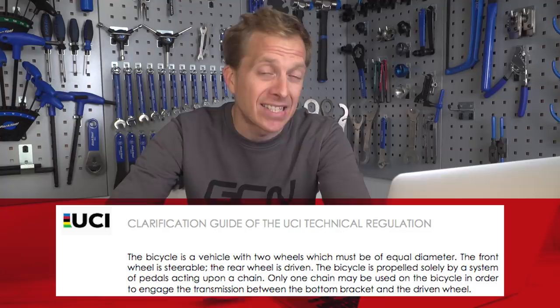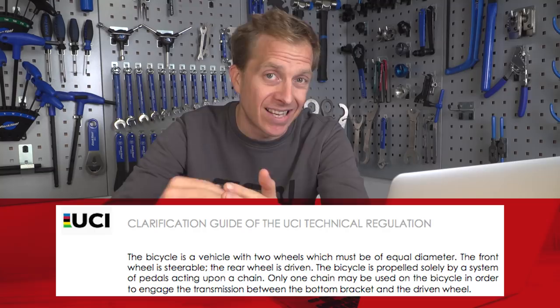Fabiano Matty wants to know: is there any UCI rule allowing rubber-tooth belts instead of chain drives on bikes? Well, that's an interesting one. Recently I did hear that the UCI relaxed — or rather changed — the rules for BMX races, so they can now use a drive belt instead of a chain, and I'm pretty sure it's been used in downhill mountain biking too. As for road racing, as far as I'm aware it's still not allowed, and I don't think anyone would want to use it, because the friction caused in that system is a lot higher than a standard chain. Plus, you're going to have to have a hub gear rather than a cassette cluster. So no, it's not allowed — to my knowledge. But if anyone out there does know, let me know in the comments.